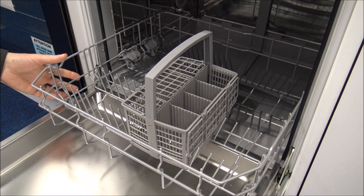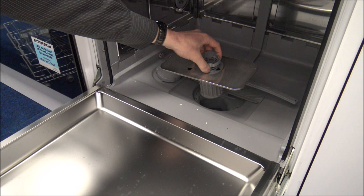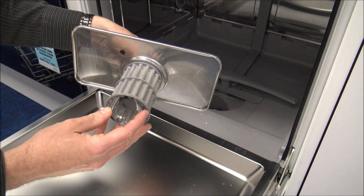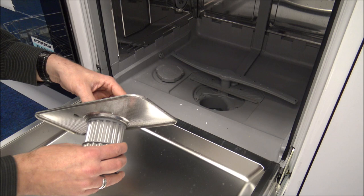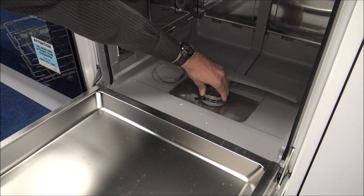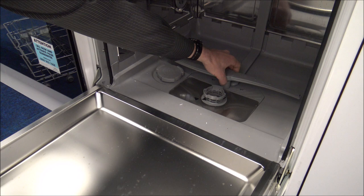For maintenance, there's not a huge amount to do. The filter in the middle is easy — just take it off and rinse it under warm water to remove any food residue. Residue stuck at the bottom can generate fault codes. To refit it, drop it back in and twist until the two arrows meet. There's also the dishwasher salt compartment — make sure you don't use normal table salt. And the spray arm just pulls off for easy cleaning.